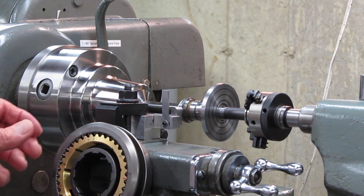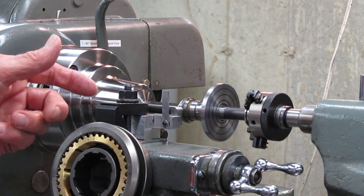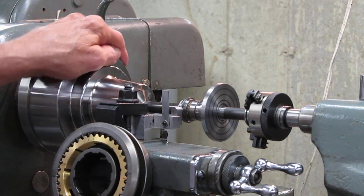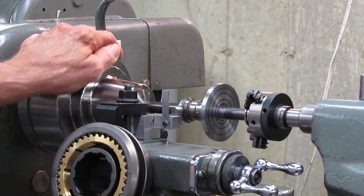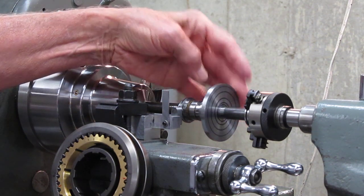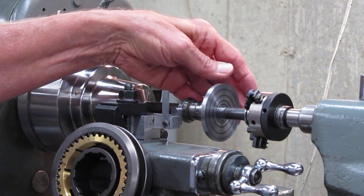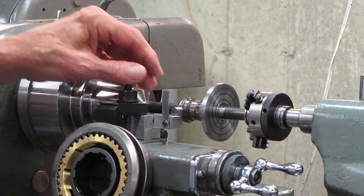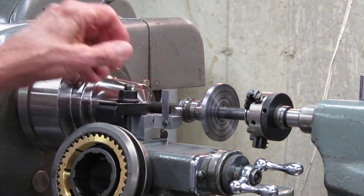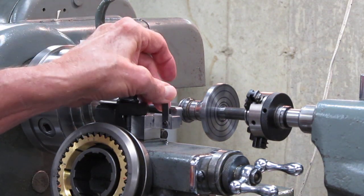What I've got here is a setup to verify that I can actually make it work. I didn't want to get too far into a project and then figure out I couldn't do it. So I built up one synchronizer for one gear, set up on the lathe here for a demo. The spindle acts as the output shaft of the transmission, and on the tailstock we've got basically what represents the mass and size of a clutch plate at quarter scale. It's free spinning, so when it's disengaged there's no connection. When you put it in gear it connects the two together, and the object is — when it's spinning and the speeds are not matched — it won't go into gear until the speeds are matched exactly.